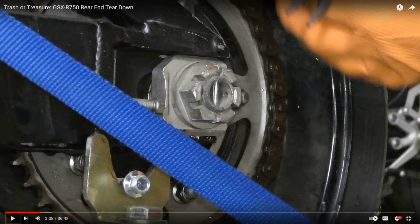If you got something like that, right? Just say you could. Just say that it's not this, but you're trying to tap something like that. It's what punches are for. But if you haven't got one, just say it's a big thing. I'm not talking about this specifically. I'm talking about anything. Instead of trying to hit the nose of something like that, put a hammer against it and then hit the back of the hammer with another hammer. And before someone starts whinging, you can hit hammers with hammers. You hit anvils with hammers. It's absolutely fine.